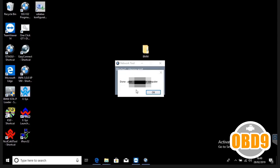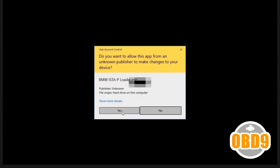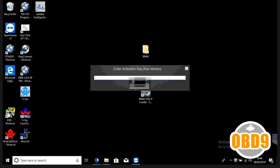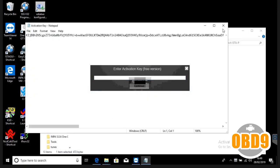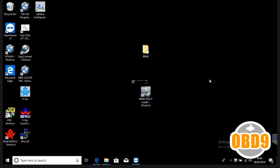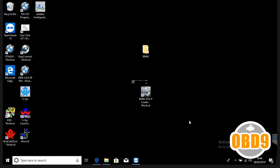Just press OK now and move on to the next stage. What we want to do next is make sure that S2P is loading. Double click on it and press yes. It's going to ask you for an activation key — remember, this activation key is where you extracted it to, usually in your C drive in the BMW folder. Copy it and paste it in, then press continue. The launcher is going to flash up at the bottom, then it's going to come up with 'shutting down' — that's perfectly normal, that's what we want to see. Double click on the launcher again, load it up, press yes.